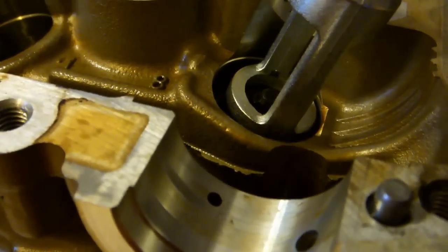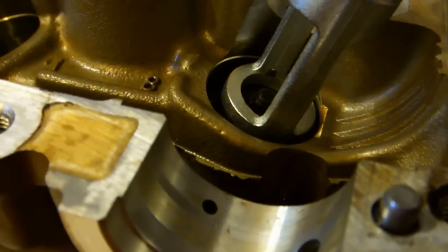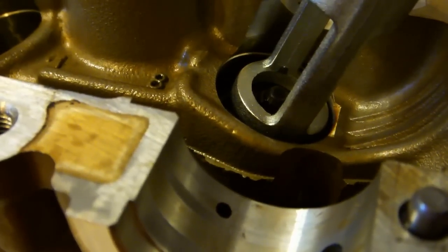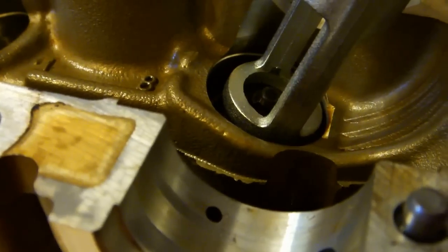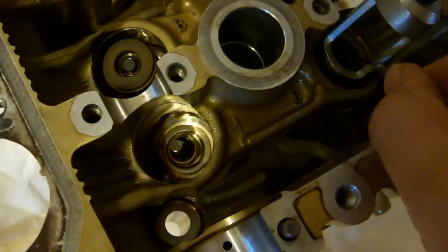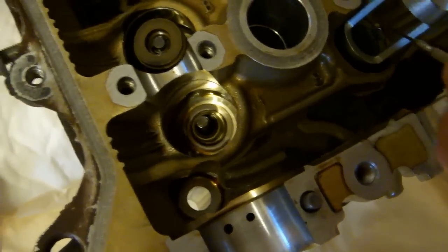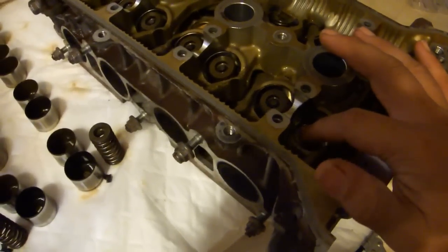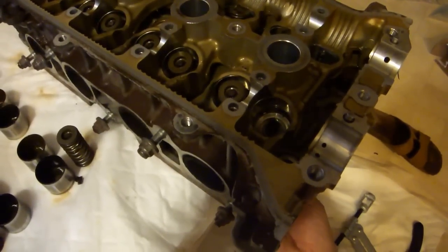If you find yourself having to really torque on the handle, then you need to remove the tool, recenter everything, and try again. If you really can't get the spring cap to go down, then you should probably get a small tube, set it on top of the spring cap, and tap it with a hammer. That's per the instructions that came with the tool. Once the spring is compressed, you can use your screwdriver and magnet to remove the two collets. Remove the spring. Push the valve stem in a little bit and retrieve the valve from the other side.